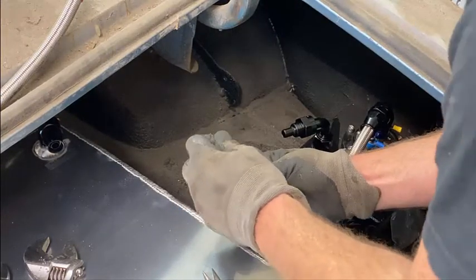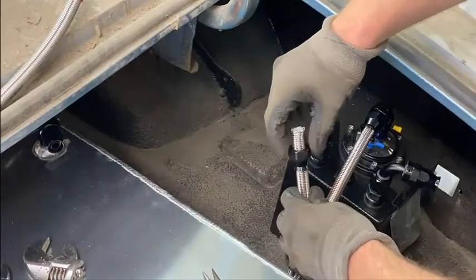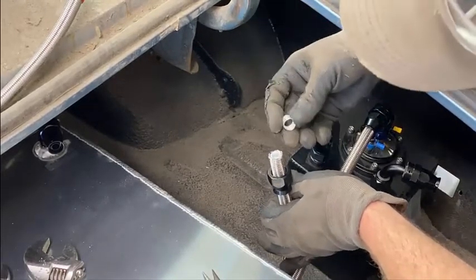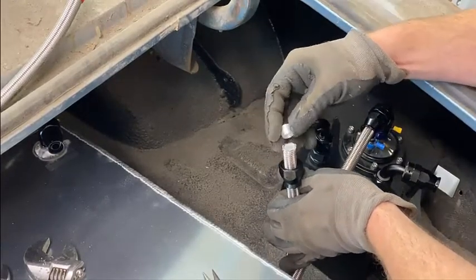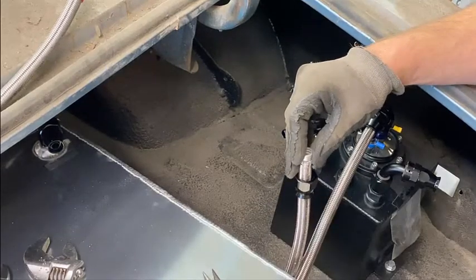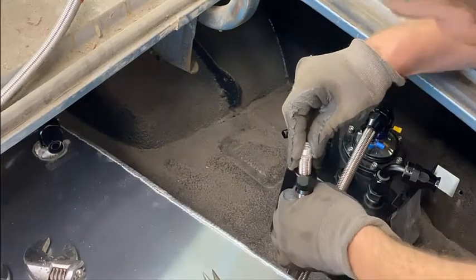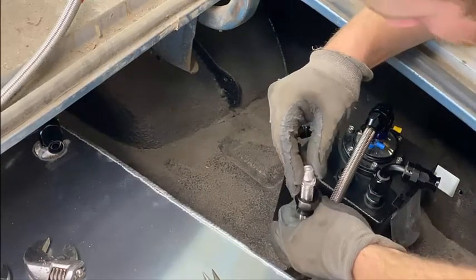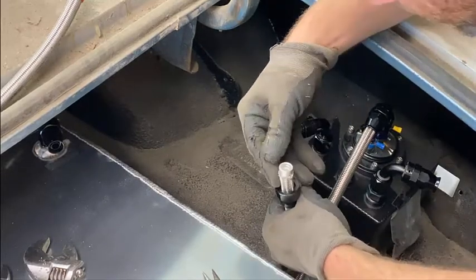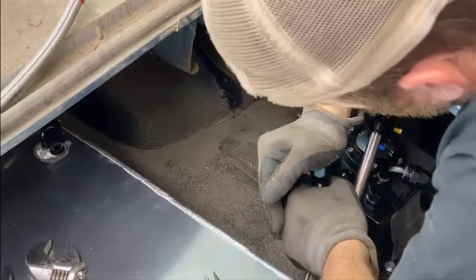All right, so first we want to get this guy over. Make sure you got all your strands. Sometimes you got to spin it. Ta-da, right? Next, this has barbs in it. It has a stop at the very end. So we'll put that in there. Hoping my hat's not blocking your view, because I'm getting my head down here. Make sure, again, no strands are getting caught in between the aluminum and the PTFE.